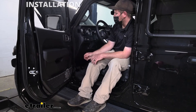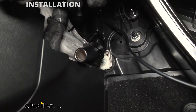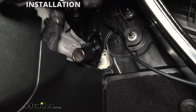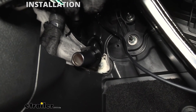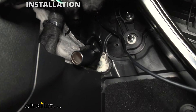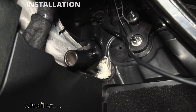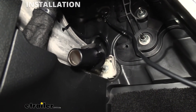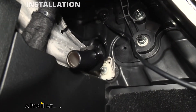Why don't we go ahead, pull into the garage and put it on together now. To begin our installation, we're going to be here inside of our Jeep on the driver's side, working kind of underneath the dash over here towards the kick panel. If you look underneath the dash, closest to the outside of our vehicle, we're going to have a piece of aluminum bracket there from the factory. That gives us a perfect spot to mount up our outlet. I've fed the outlet through the included bracket and simply used one of the provided self-tapping screws to secure the outlet bracket to that factory aluminum bracket.